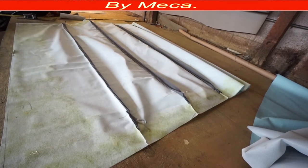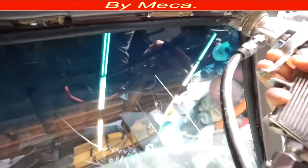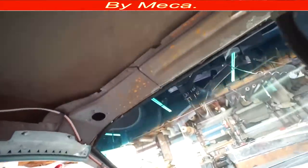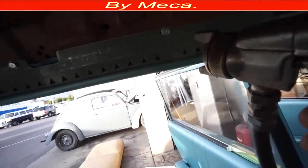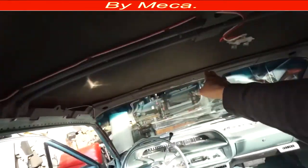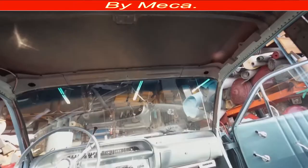I'm putting a lot of glue because this material doesn't stretch at all. I'm also going to put glue right here. This headliner comes with quarter-inch staples, but I'm also putting glue — not because I feel insecure with just staples, but I think it's stronger to apply both glue and then a staple. It's very important to put enough glue — especially in the back area. I put glue all around the back. I've shown you part of this process.